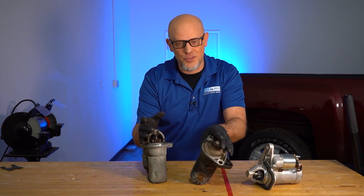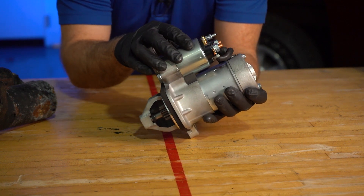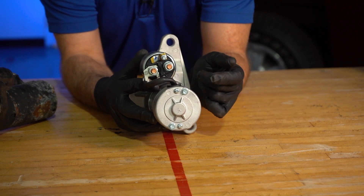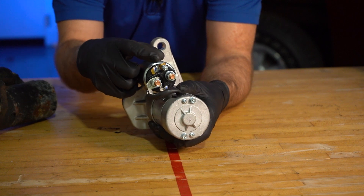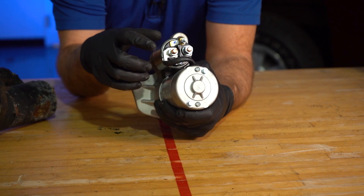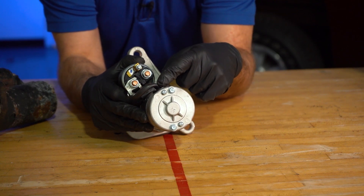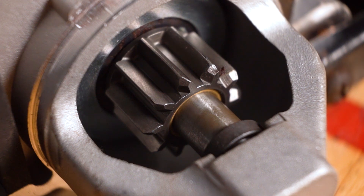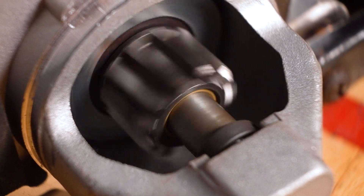These are the two failed starters from the sounds you heard. Before we look into these, we're gonna talk about how a starter actually works. There is a solenoid where you have the connections that go to it. You have the power going here and that's gonna be hot all the time — always battery positive. Here is the switch, so when you turn the ignition switch, that is gonna put power here and command the starter on, and you have a ground here. The ground is grounded through the body. When the starter is activated, this little gear right here is gonna pop out and turn a flywheel, and when the flywheel turns, that turns the engine over.